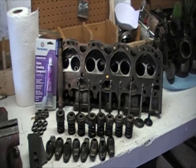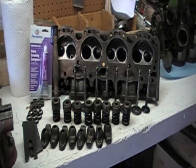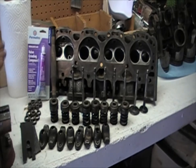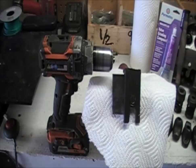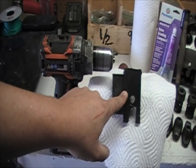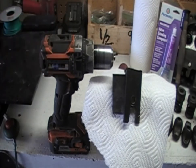So let's get started. This is everything you're going to need to get this job done. You are going to need some lapping compound — Permatex sells lapping compound, they call it valve grinding compound. You're going to need a tool to grind your valves, like this little thing with the two suction cups on either end. Note that if you are buying new valves, you will still want to lap them so that they are seated. An optional tool that speeds up the job is if you weld up one of these — it's a valve compression tool. The other alternate tool you can use is a drill, and I find that the drill actually speeds up the process 100%.